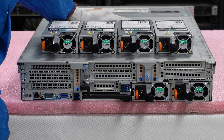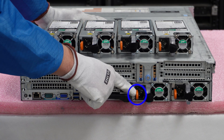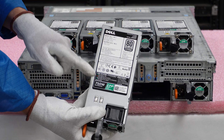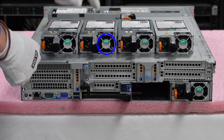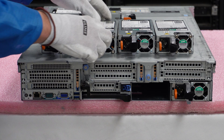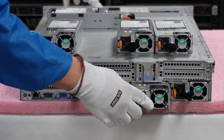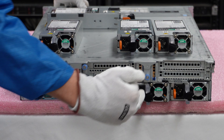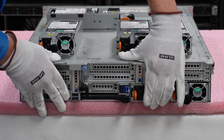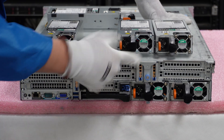All right, I have my ESD gear on and we are safe to work on our machine. It's really easy to remove — let's say this is a bad one. You're going to push the orange tab right here, hook your finger on this clip, and it'll just slide right out. This is a 750 watt, so we need to make sure we grab another 750 watt. We'll grab our 750, line it up, and slide it in. When it gets right here, you'll see it clips into place. It is firmly in there — it's a really easy upgrade overall.